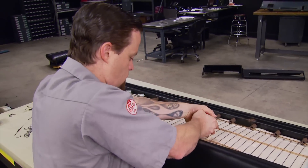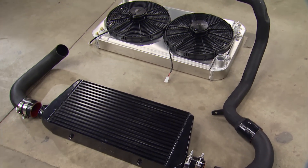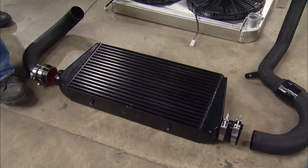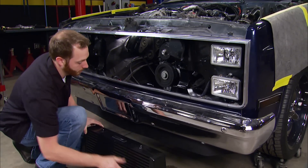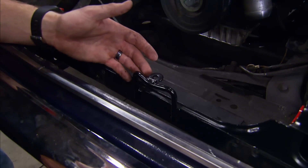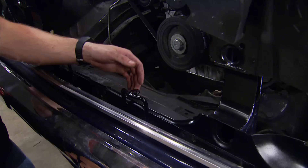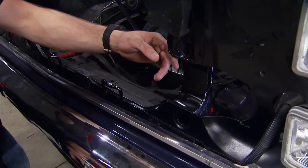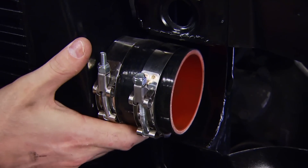Back at the front of Project Nitrain, these are all the parts we're going to need to finish up the cooling system on our Duramax. We're going to start by installing the intercooler we picked up from Summit Racing. I got out the welder and built these custom mounts for the lower part of the intercooler. I also had to trim a little sheet metal, and to accommodate the 4-inch core of the intercooler, I had to cut and reinforce the edges of the core support. This will all let the intercooler sit behind the grille.